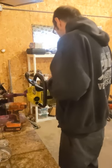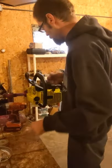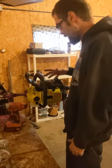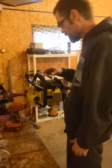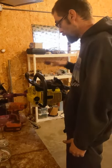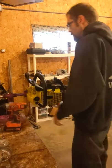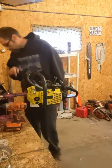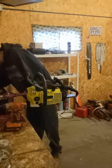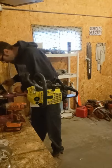Now this saw is a big bore. Being a big bore, we're probably not going to cut up in the cylinder squish band, because with big bores what they do is lower the piston skirt because it overlaps the case. If we drop it too much, we're going to get into a three-point issue real fast, so we kind of stay away from lowering these too much. We can lower them a little bit, but you can't really push them down like you can with a non-big-bore cylinder.